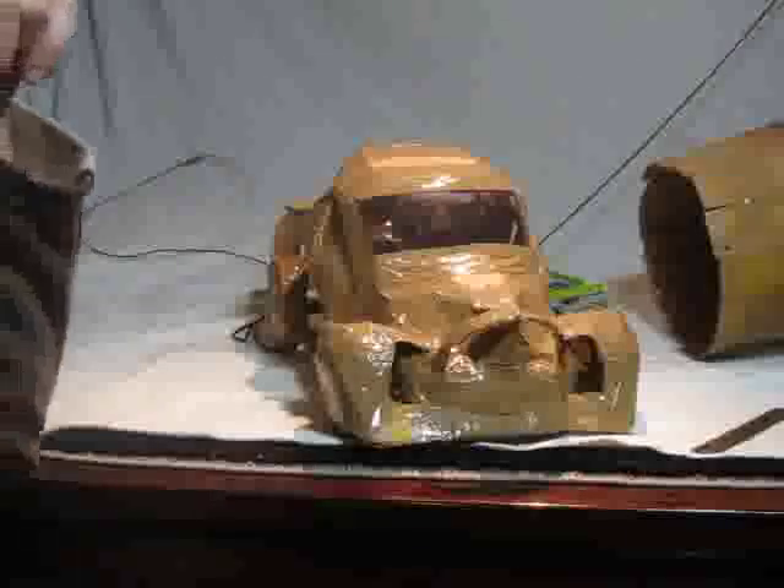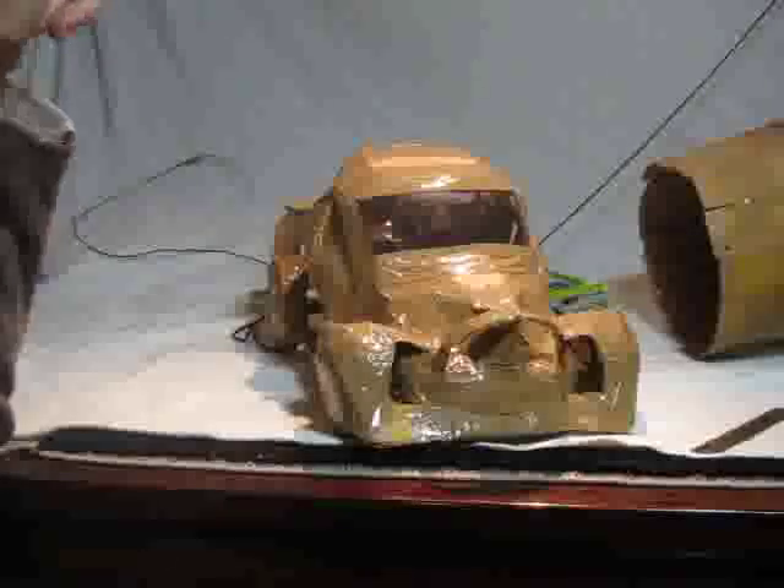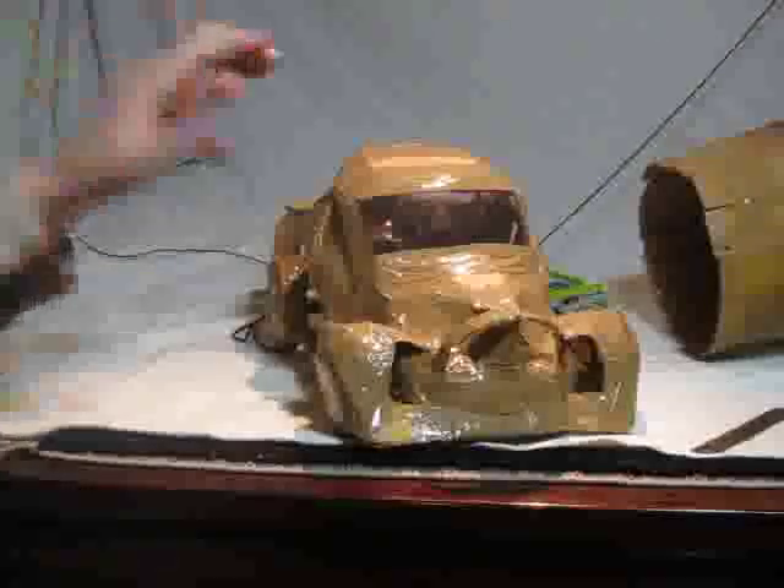It has 200 Newton metres of torque peak — just amazing. That's complete overkill for this application, but it's the only one we can find that's 94–95% efficient. Most other brushless DC electric motors are 90% at maximum RPM. We still need the gearbox in order to achieve both climbing the gradient and doing 60 miles an hour. We've got room for that at either end, as front wheel drive or rear wheel drive.